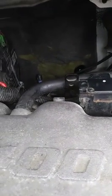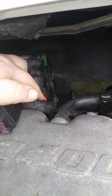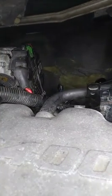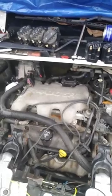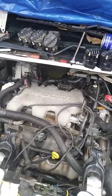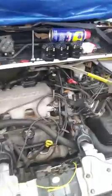I actually ended up having to pull the alternator because my plug back here, which is number 5, no, let's see, not sure what number, it's number 4. That plug was in there. I mean, it was seized up. My guess is it was the original factory plug, which has 200,000 miles on it. So when they're in there that long, they get stuck pretty good. So I had to end up pulling the alternator in order to get that plug out because I couldn't get my arms back there. But yeah, so it's pretty much required to pull the plugs and coils off this thing.